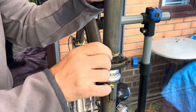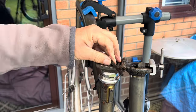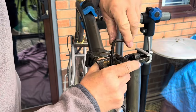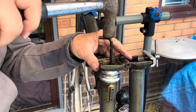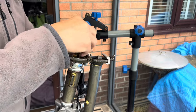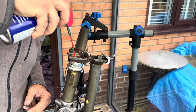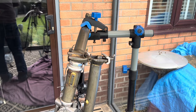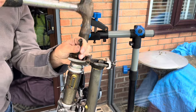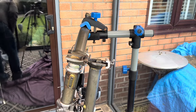Removing the front stem was also problematical. The wedge inside was really firmly stuck. The procedure is to rotate the bolt four turns and then tap it with a hammer to knock it down and release it — but it really didn't want to release. I used some WD-40 penetrant to help loosen it. Once I got in there, it was well greased anyway; the problem was you just couldn't get enough force with it in the frame. I dropped the bike onto the floor and hit it with real force, and eventually got it to go. It may not come out as simply as it appears in some videos.